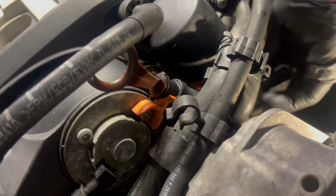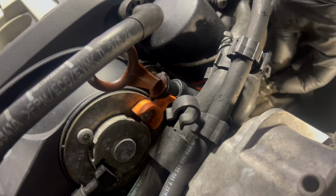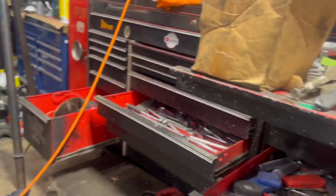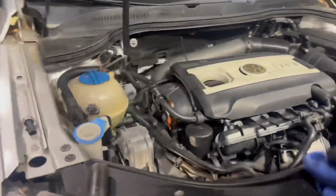It would really be great if you have starting fluid or brake clean or something, because you want to clean the plug itself out. Ready? Here you go. Look at my hand. And mind you, I drove this around, and about 20 minutes before I drove it around, I took this out and drained this already once. And then it ran pretty good for a while. But all that oil was inside of that sensor, in the wrong side of the sensor.